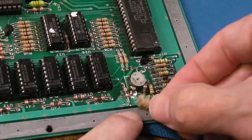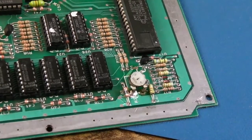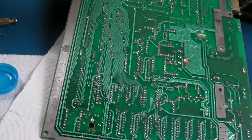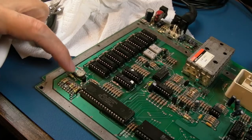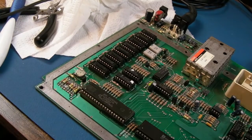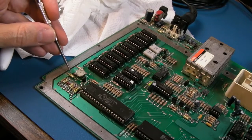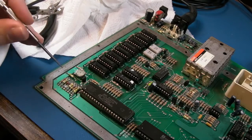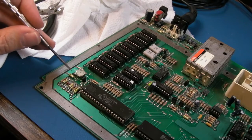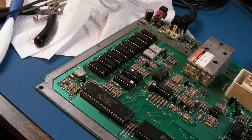Yes, the left hand pad is joined up properly. That right one though, I'm not sure what's going on. Yeah, so we got no colour again. It's this leg down here because there's no pad. I actually think the crazy amount of solder was to join to maybe a tiny bit of a trace from down here maybe. I'll test that on continuity, but I think what we need is a wire from there to there, which I would route on the underside rather than having huge amounts of solder and just making a mess.